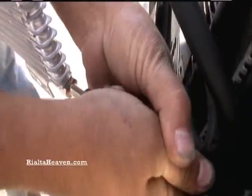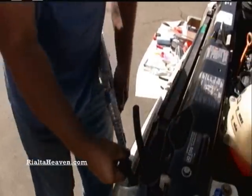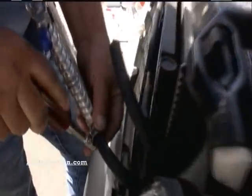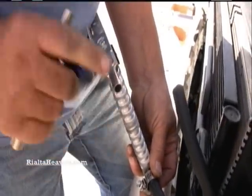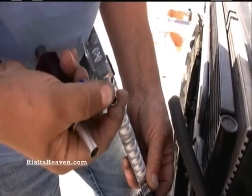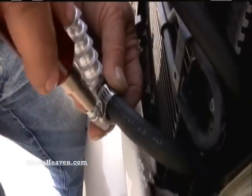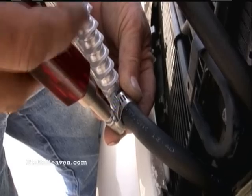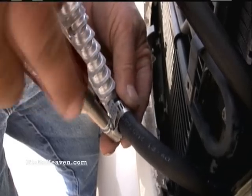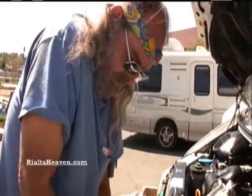It can require a little bit of force to get these on — snug it up really good. The way these fittings are made, they have one barb, so you're clamping over here just trying to keep it from sliding over that, so it doesn't have to be super duper tight. Try to keep the clamp away from the barb so it won't tend to cut the hose. Keep the tightening bolt straight up and down to make it a little easier to get to.